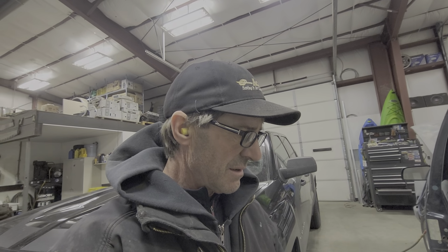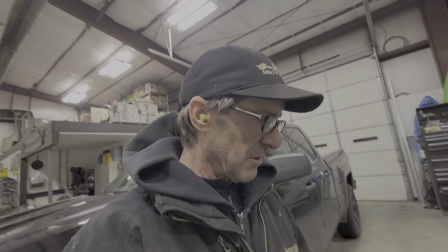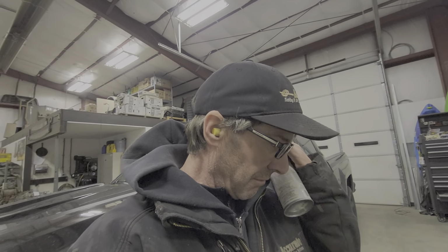It doesn't necessarily help you weld, but it actually fixes up if you've got rusty areas and stuff. It's a good idea to use a bit of this. You get a better conduction. Anyway, I'm going to pull that piece back out, spray a little weld-through on it, and going to spot it in there. Okay, hang on.